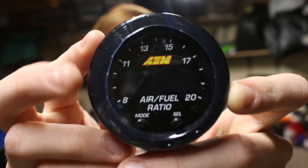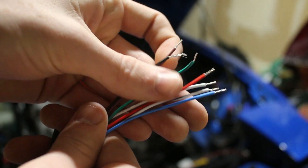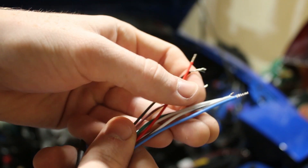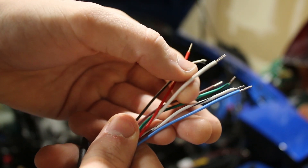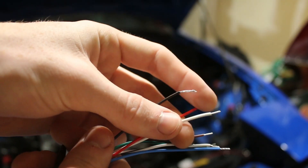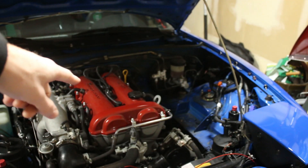Welcome back to day two of the ECU install. I already have the Mega Squirt in and everything it needs to run. However, we need this - an AEM air fuel ratio wideband gauge. We're going to install this, hook it up into the ECU, tune the ECU base map, and then we can start the car. These are the wires that come off the wideband gauge - we only need three of them: the black one for ground, the red one for 12 volt power, and the plain white one for wideband output. I have to extend the black and white ones so they reach into the engine bay.